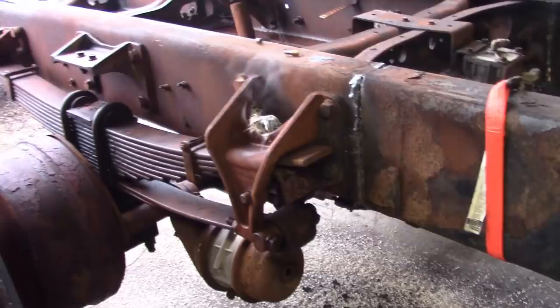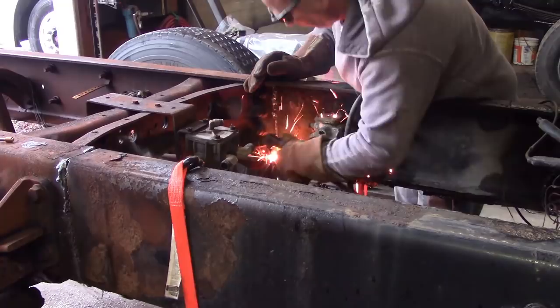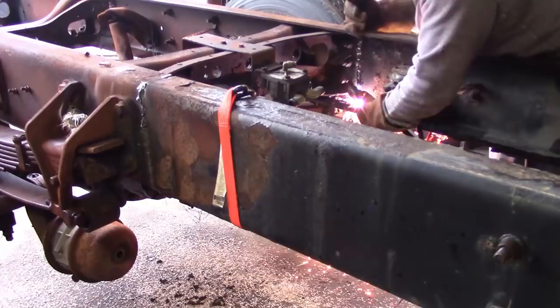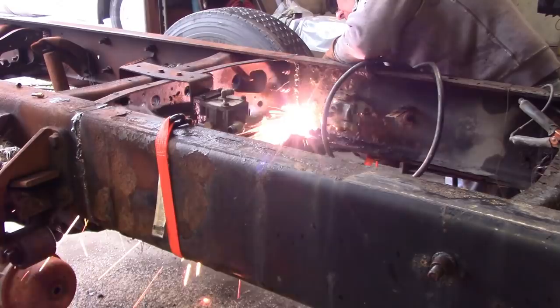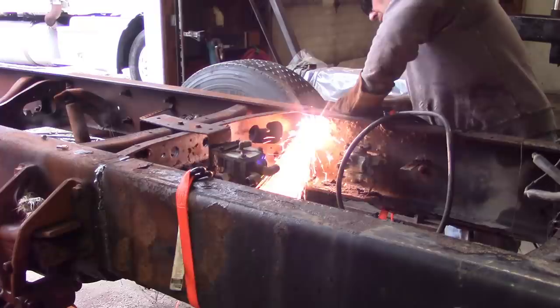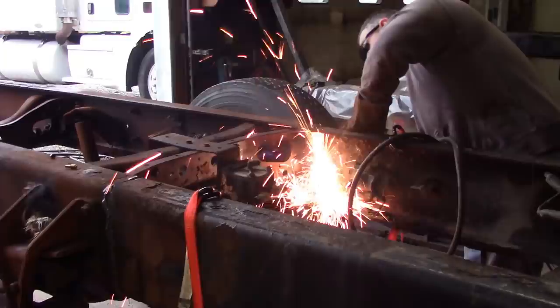I've got another suspension already sitting there and we're going to bring it over and get it ready. I'm not going to be doing the drilling like I've done before because this is not the same suspension — so I'm not going to have my story pole. I'm going to do something different to line up my holes. I don't have to disconnect any air lines or wiring because in the fire it already melted off. The air brake relay valve is no good, the ABS valves are no good, so we're going to be taking them off of another truck.